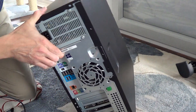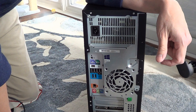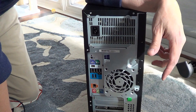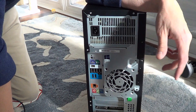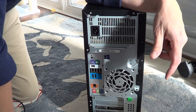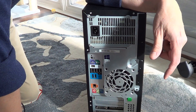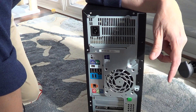It's ready to plug in. When you plug it into your computer and set it all up, it's going to look for drivers. It'll take a minute sometimes to boot or post on the screen, and your resolution will look low. If you pre-install the drivers you can do that, though I typically don't. With Windows 10, you'll get a lower resolution initially, but then just go to nvidia.com or amd.com, look up drivers, put in your card's specifications, and download them.